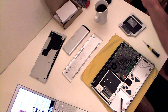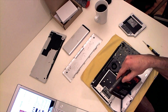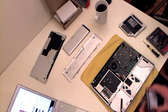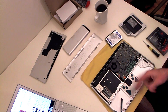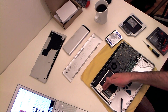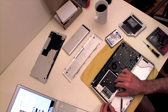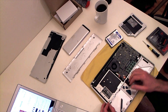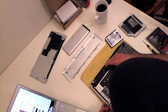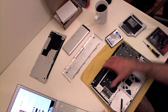You want to put the solid state drive where your old hard drive was, because people have reported issues with the sleep option when it's plugged into the optical drive bay - when you try to put the computer to sleep and wake it up, it wasn't registering right.